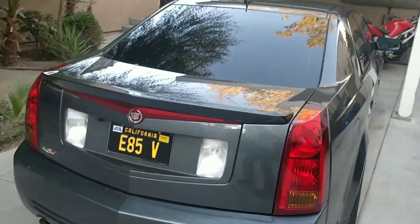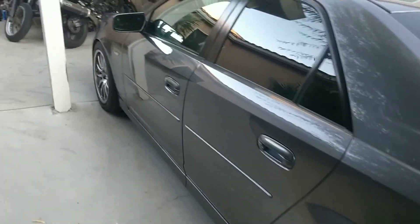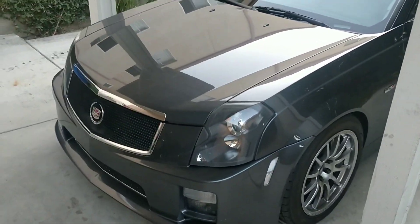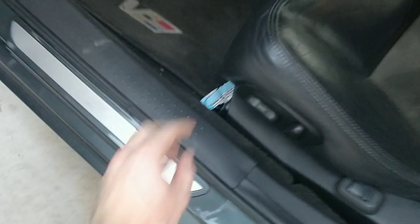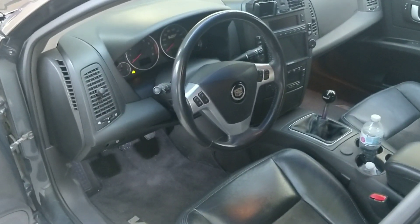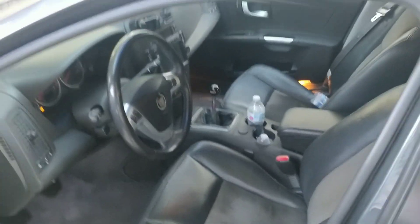It's got the stealth lift. Thing's got about 85k on it, really enjoying it. It's got a few other mods — I have the KW V3s, this is not stock ride height, and the damping on these is oh so minty, really really rides nice, handles well. Has the poly diff mounts, poly engine mounts — all the good stuff you want on one of these. It's got an LS2 in it making 400 horses, rear-wheel drive, T-56. It's basically a four-door Corvette.